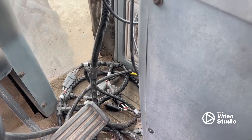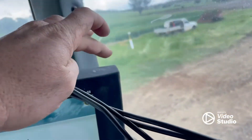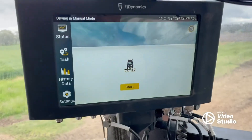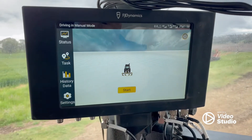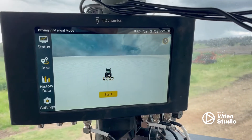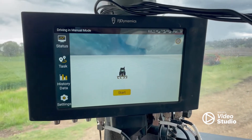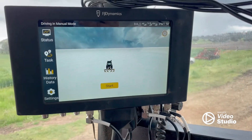It does have a master switch down in that really messy wiring loom, and that switch does have to be turned off when you park up. If you turn it off at the normal power button, it'll just stay on and flatten your battery over a few days. It's not too bad if it's just overnight, but if you're parking up for a week, I came back and found the battery was flat and eventually worked out that was why.